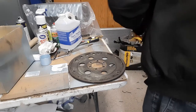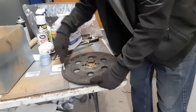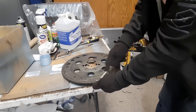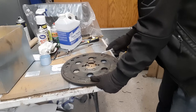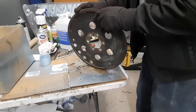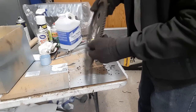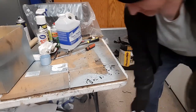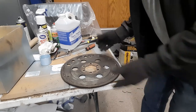I've been repainting a couple of brackets, painting some pulleys. The backside here — hopefully this isn't too full of dirt. I do all that other balancing and then I go and attach this to the engine and this thing is all messed up — that ain't gonna help. So we'll make sure this thing doesn't have any extra weight and dirt on it. Inspected the teeth, everything seems to be okay. I never had any real problems with my starter at all, so everything appeared to be in good shape. There's a little chamfer on the start of the tooth, just a little bit, but nothing more than I would expect — she appears to be in good shape. We're gonna clean this guy off, and it's the one last part to clean before I put the engine back together.